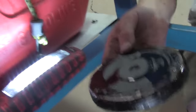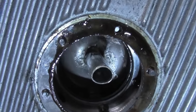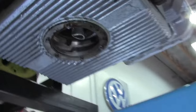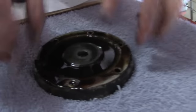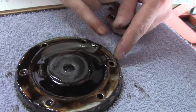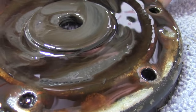They've installed this without a sump screen. Taking a look up inside, there don't seem to be any metal filings on the sump plate. It's pretty black, which is pretty normal. Getting down to the bottom, there seems to be just a little bit of shiny stuff sitting in that oil — nothing that indicates a massive bearing failure, but it has had some stuff going through here. This doesn't necessarily condemn the engine, but it does say this motor has been run and is probably not a fresh rebuild.